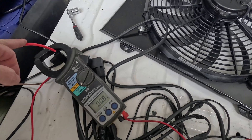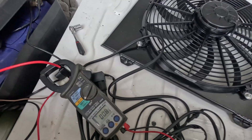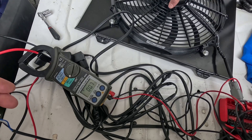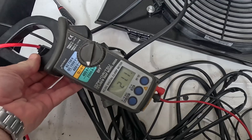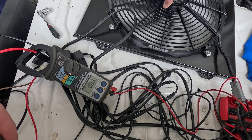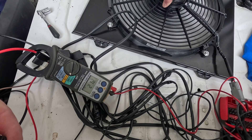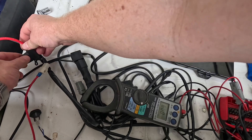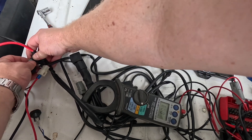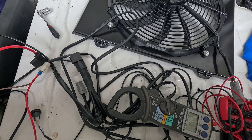I've just got an amp meter here to test the amps. This is a 60 amp motor - that's probably just the starting current. The Haltech computer can put a soft start on it, so I can set it to start at 10 or 20 amps, which will take a lot of the big current draw off startup. You can see it's only drawing 20-21 amps when running. The starting current was a little higher - about 40-50 amps on startup. I'll check this fuse - it's a 35 amp fuse and we haven't melted it yet. With the soft starter on the Haltech, it should only draw the amps I set, so I might set it to a 20 amp soft start and then it'll run at around 21 amps.